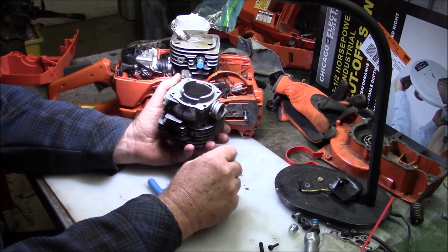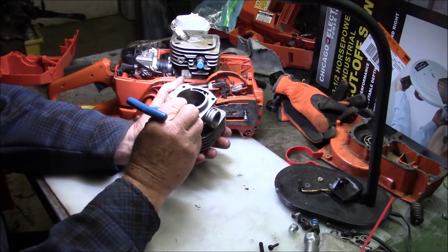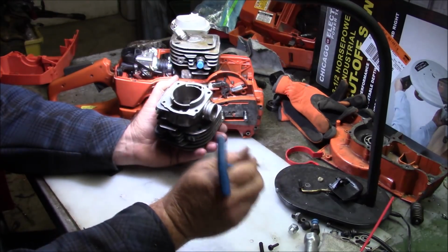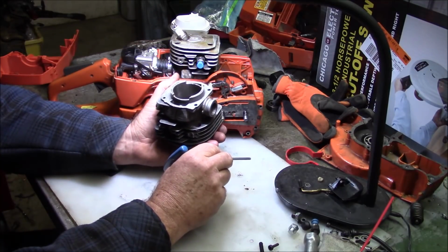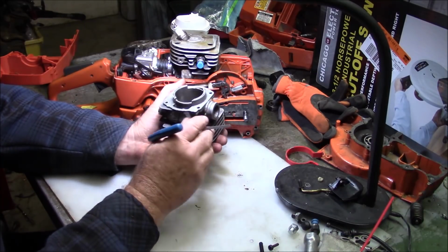Now what happens is there's a step where the piston crown is now a little further up that transfer, and you have this square edge where now the gas air mix coming up through the transfers hits that piston, has to bounce up a little bit. You're almost creating a turbulence. Well, no, you are creating a turbulence, which actually cuts the cross-sectional area of that transfer.